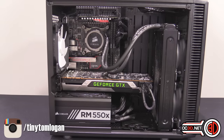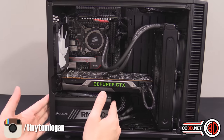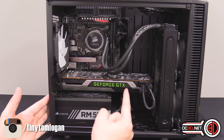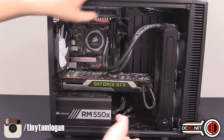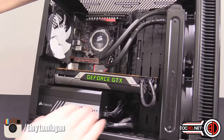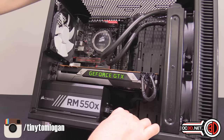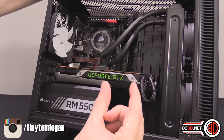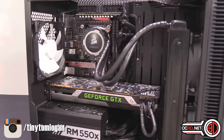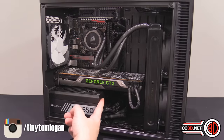Now, talking about power supplies, I would say on the absolute outside edge, 160mm long power supply. Don't go any longer because you'll block the grommet at the back. It's actually quite a difficult case for me to be able to show you all the cables and everything around the back, but there really isn't a great deal of room at the back. You've probably got about 10mm after the end of your power supply, which makes things very tight. So don't go any more than 160mm long.